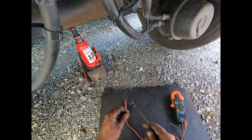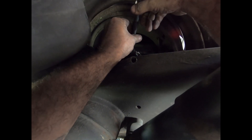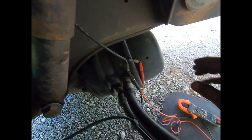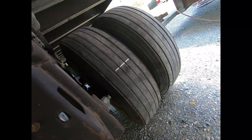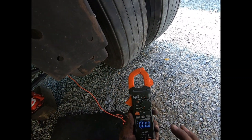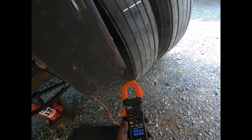Set the meter on AC voltage. I'm going to plug in at the actual speed sensor — not at the extension cable at the ECU like I did for the resistance test — just to show where that connection is. Polarity doesn't matter for AC voltage measurement either. To do this test you need to spin the tires: it should take two seconds to do one full revolution, and at that rate we should get at least 0.2 volts AC. The voltage should go up the faster you spin the tire.